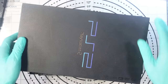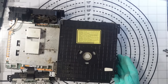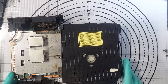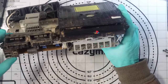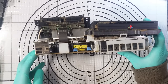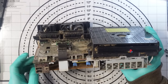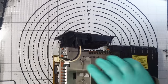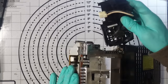I'm just going to remember how to take these apart. One thing we've got to be very careful of is that the power supply is underneath here, and it's going to be very very dangerous to touch until it's been discharged. I'm not going to discharge it in this video — I'll just be careful not to touch the exposed PSU PCB. A friend and Discord moderator mentioned the power supply often fails on these, which could cause no-power issues.